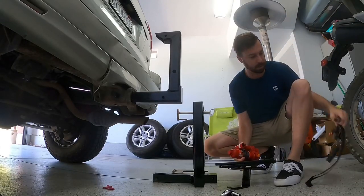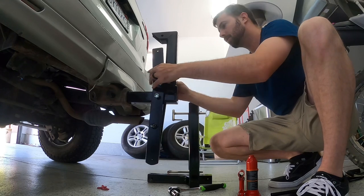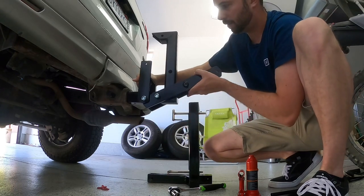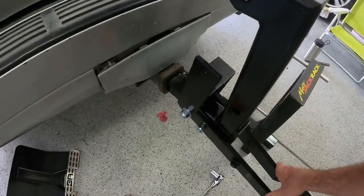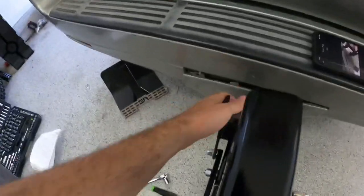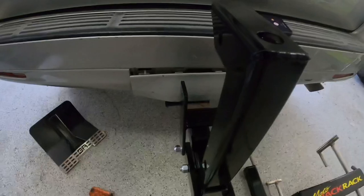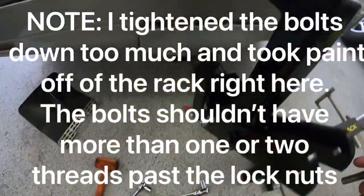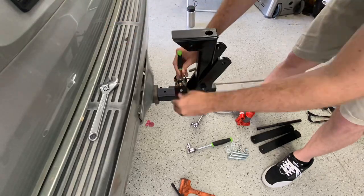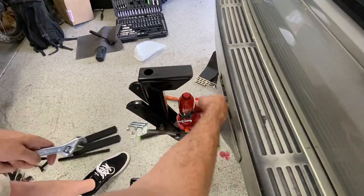Here's the jack and the rest of the components. We get two nuts on the outside here. This is our jack perch — it's going to come up and lift the bike up. It should look something like this, and it should be able to rotate independently. Washers do go on the outside of just this piece, just not on the 4-inch bolts. So the next step is to line these guys up and put the safety bolt through. Here I'm just installing the 2-ton bottle jack. You have this bracket that holds it in place — pretty easy and straightforward. Everything goes in just as you would think.